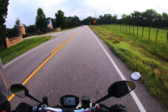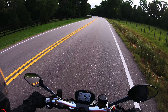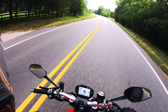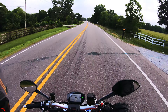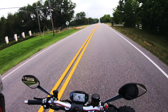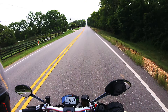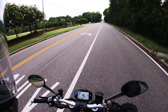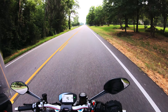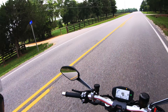Eight clicks out was my sweet spot. When I got aggressive and blew into a turn, the front didn't skip around — it seemed to turn in and glue to the ground really well. It was really enjoyable. It still felt a little harsh when just cruising, kind of like how it was at the beginning, but that's not why I bought this bike. I bought it for spirited riding — hitting twisties, back roads, getting on the power out of a turn. The stock suspension just couldn't do that for me.